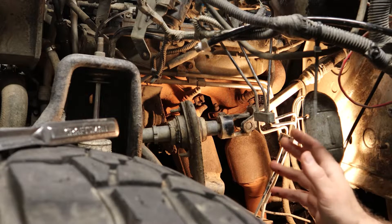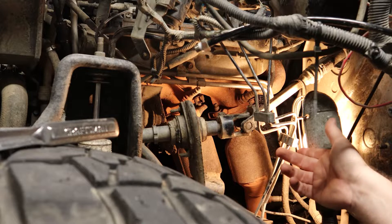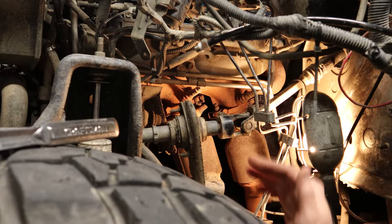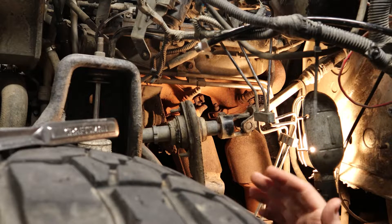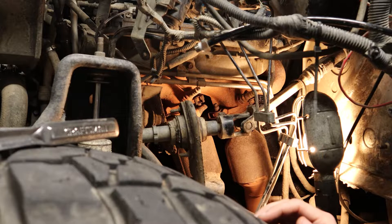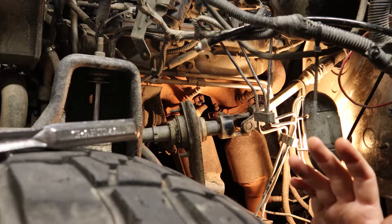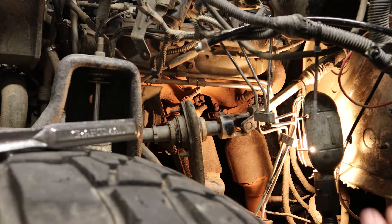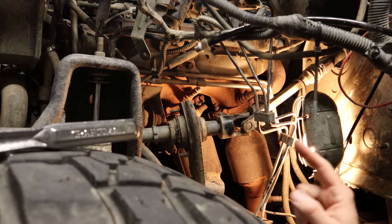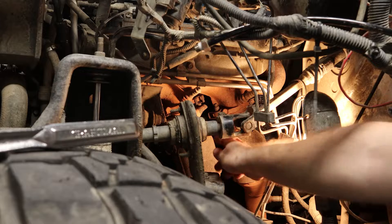I tried that like two years ago. I got on there with a ratchet and I was able to get onto one of these nuts, but I wasn't getting a good feeling out of it, which is why I decided to shelve the project until now when I wanted to pull off the whole fender and try to get better access. Now one thing that better access will let me do is get some PB blaster, liquid wrench, whatever you want to use, onto these threads. For several days now I've been soaking them in PB blaster - I think I've done it three times since I recorded the last part of this video.